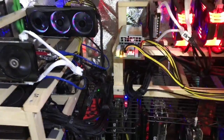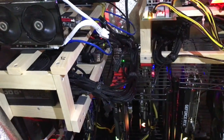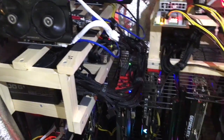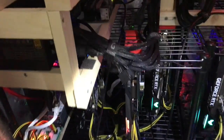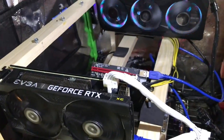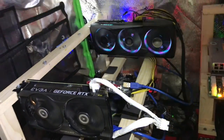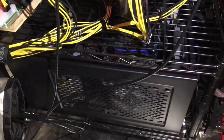Even for stuff in a garage, you need to protect GPUs — not just to isolate and exhaust heat, but to keep cards dirt, dust, and bug-free. They're an investment. Down here I have three 3060 Tis getting 50 megahash each; I pulled the 3070 Ti out due to heat issues. Below that is a rig with six various 1660s, 1660 Supers, and 3060s.